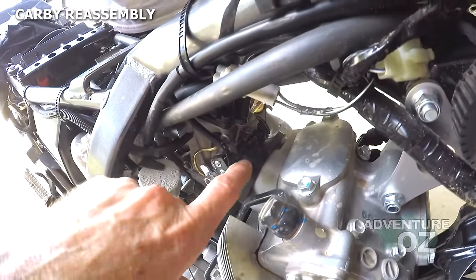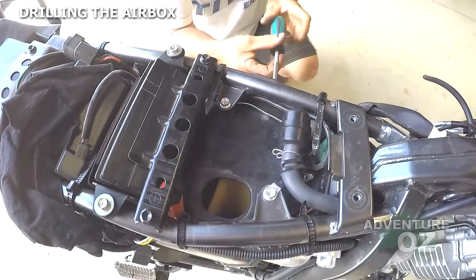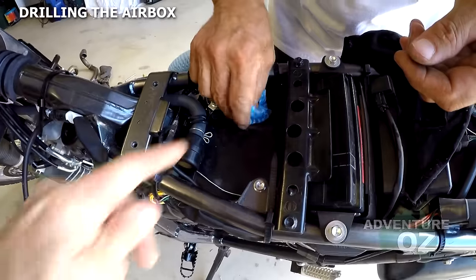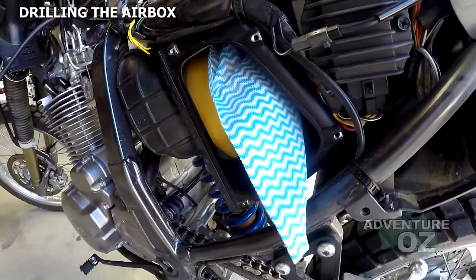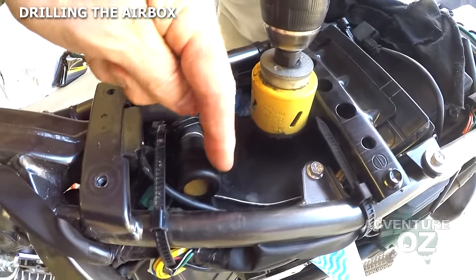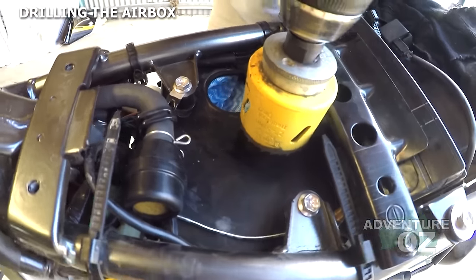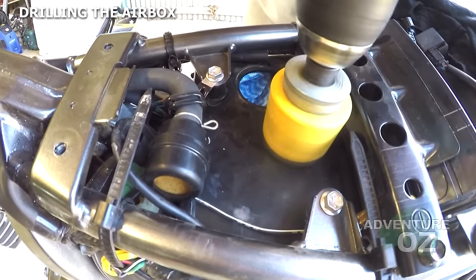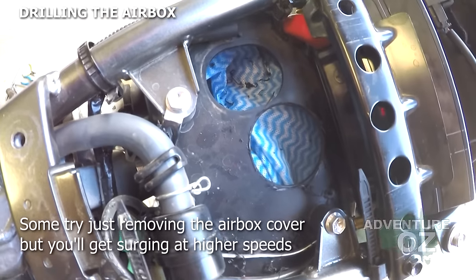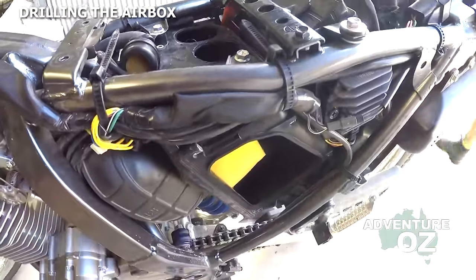There is a notch there and a notch there to allow you to line the carby up correctly. Now it's time to drill the air box. These nuts can come out easily if you're not careful — we usually put some cloth in here prior to cutting. The hole is two inches or 51 millimetres. We keep this as far away from the breather as possible — if you go near this breather you're going to interrupt the airflow, which we think is the main cause of surging. Gordon's done a lot of experimenting with smaller holes, bigger holes, and different positions — this is the one he's found best, and this size works well regardless of how much further you go with the main jet size.